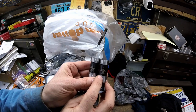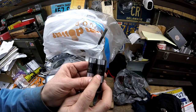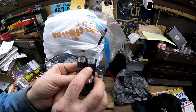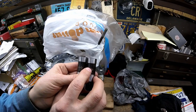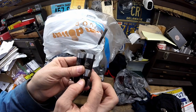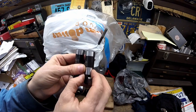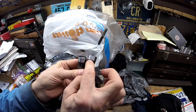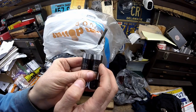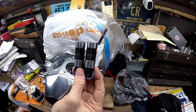You can also buy the lifter limiters separately and install them into your factory lifters. The lifters have a part number on them: 330-0724. If you're assembling a Shovelhead using factory lifters, the holes in the lifters have to point towards the oil passage in the tappet block. But with these S&S lifters and all Evos, they have a cutout — they're not all one piece — so these can face either way and oil will travel around to reach them. I still try to face the holes toward the oil port in the lifter block.